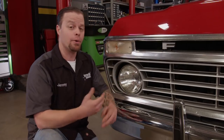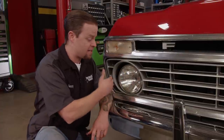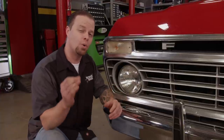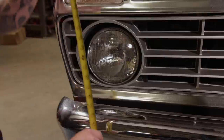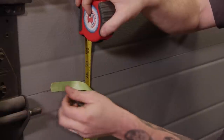And that's the headlights. In order for headlights to meet DOT requirements, they have to be aimed in the proper direction, both side to side and up and down. So if you've modified your suspension, there's a good chance the headlights aren't aimed properly — that could blind oncoming drivers if they're aimed too high, but if they're too low, that can hurt your visibility at night. Headlights aren't something you typically think of when doing suspension work, but this is very important for your safety. So I'm going to show you how quick and easy it is to check and adjust your headlights. First, we'll pull the truck up to a wall and make some reference marks — we want to first make a horizontal mark at the same height as the center of each headlight. Ours are now 26 inches from the ground, so we'll make a tape line that high off the ground on the wall.